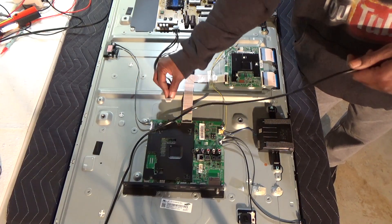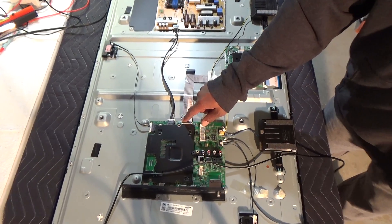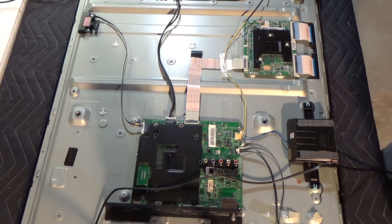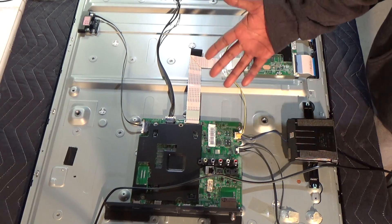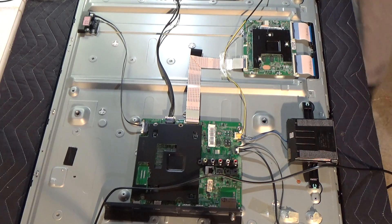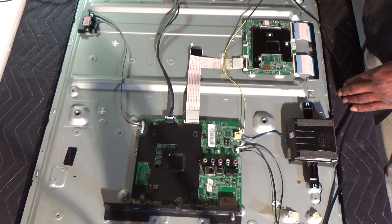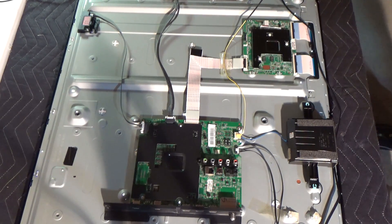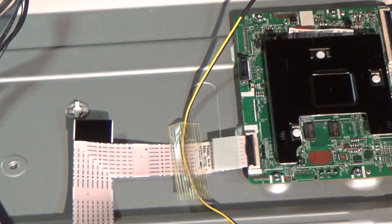I'm going to plug this cord back in. Now what I'm going to do is unplug this wire from the main board down to the T-Con board — that's our LVDS cable. I'm going to unplug it right here. Just make sure you unplug it from right here, because if the TV is okay you're going to short something out if you touch these contacts on the end of this plug to the metal chassis. I'm going to plug it back in, put my light off so you can see, and plug the power cord back in. And voila — backlights! You may be thinking it's a T-Con board. But I did notice something.